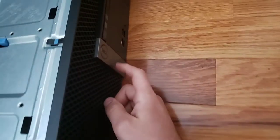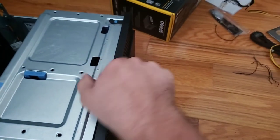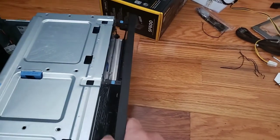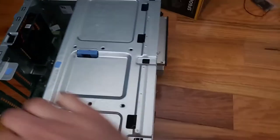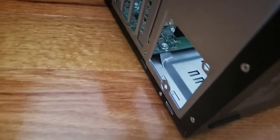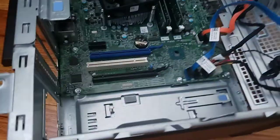While opening your case, make sure you disconnect any USB antennas — I already broke two of them by leaving them in and popping the cover off. Be careful when you slide it forward because it totally separates from the USB ports. I already took out the three screws — one here, one here, and one here.